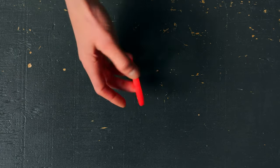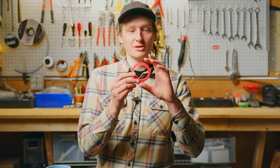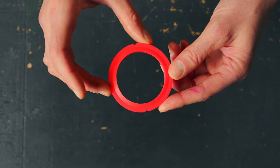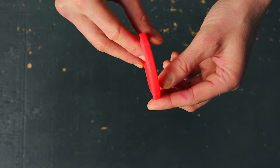First up, we're going to be talking about our red La Marzocco style gasket. This is going to fit your La Marzoccos, your Mavoms, and your Slayer systems. This gasket is going to measure 72 millimeters outer, 55 inner, and 6.35 in thickness.